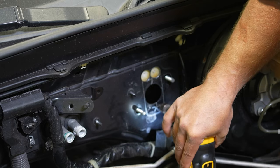Cool thing is this fitting gets the drain outside of the transmission. It comes with this bracket that bolts to an existing bolt hole right here next to the housing, keeps everything tidy and out of the way. And also this speed bleeder bleeds the fluid outside the bell housing, so it makes it nice, clean, and you don't have to worry about getting any fluid on your clutch and important stuff like that. So we're gonna dive into getting these fittings installed next.